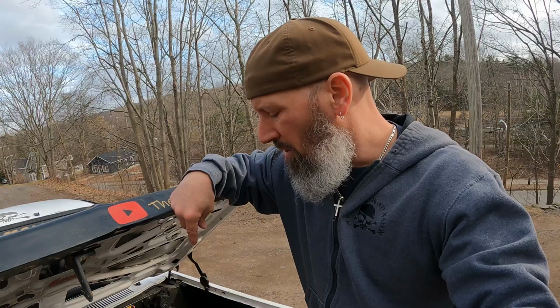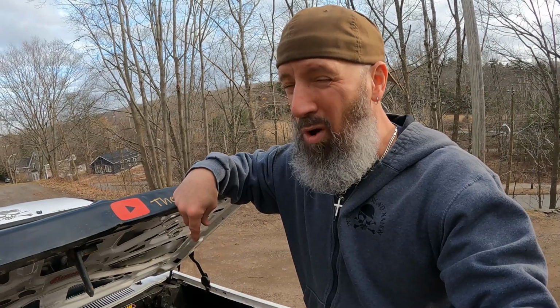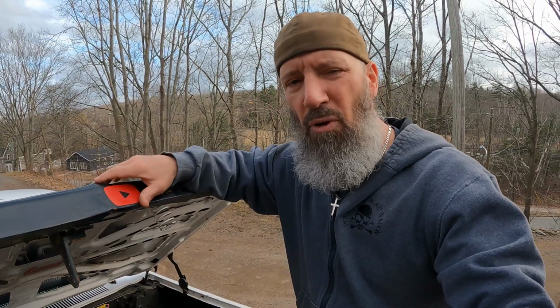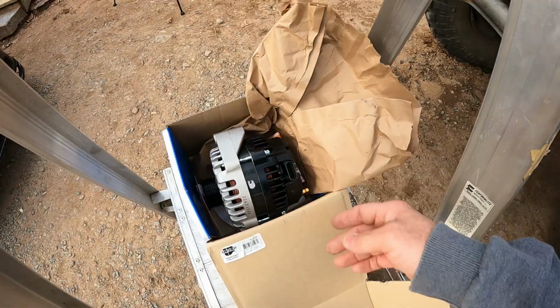Now with that 4-pin alternator, I only use 1 or 2 wires on it, but it has an internal voltage regulator, so I can get like my 14.3, 14.5 out of it. So if you're interested in seeing that video, check it out. It's back on the channel rather, I'll link it in the description. So yeah, let's get to work on getting this thing swapped out. Hopefully we get rid of that squealing because that is annoying as hell.